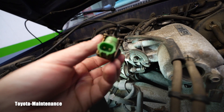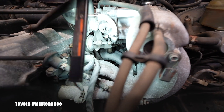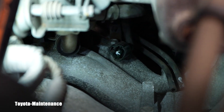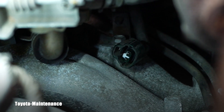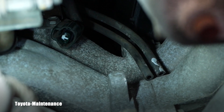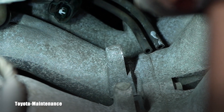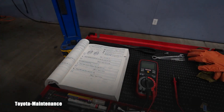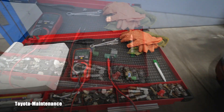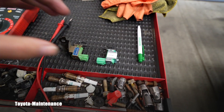The VSV was located right down there, held by a 12-millimeter bolt. In the back you can see the connector — there's an electric connector and two vacuum lines which come down there. The bracket was mounted right there in the center of the screen. The manual describes how to test it, but it's actually very simple.